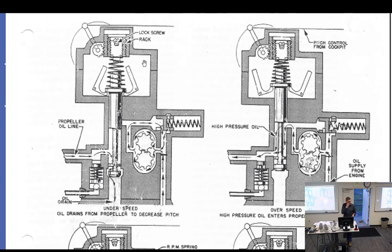There are three positions the fly weights can be in: under-speed — where the spring presses them in; on-speed — where everything is in equilibrium; or over-speed. The governor always wants to be on-speed. When you adjust the prop governor, it releases or adds spring tension, lifts or drops the pilot valve, sends or drains oil, the prop changes pitch, and the engine speed adjusts back. It's constantly making tiny adjustments to keep the prop on speed — that's its only job.